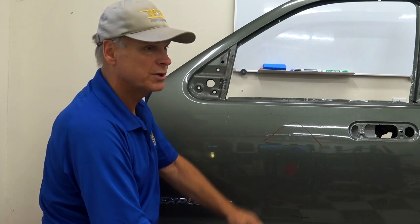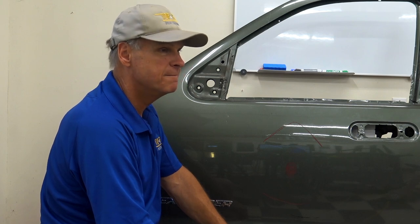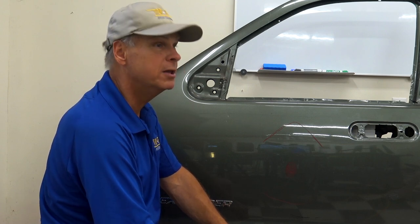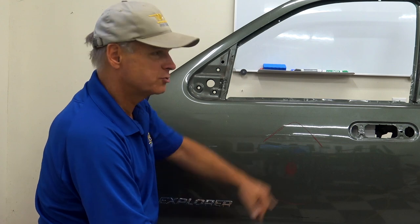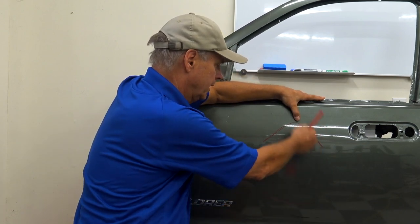At the most. Quarter size, you're gonna be there a long time with a sharp tool. Unless you have a power box or access to something like that, you could be there a half hour. You watch that video on stretch metal, well, that could be you. And after about 10, 15 minutes, you're going, oh my God, shoot me. So, a quarter size or less, dime size actually when you start, no more than dime size, guys. And I'm not going to bother going over stretch metal because you know what that is. So now, we can hit hard enough to form a 90 degree crown.